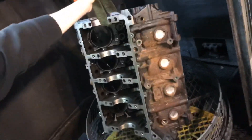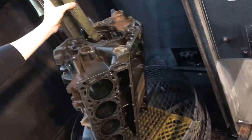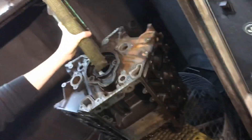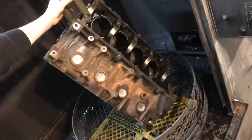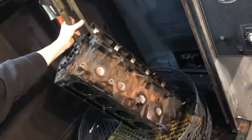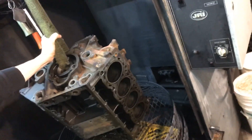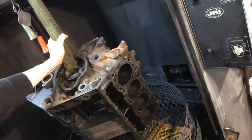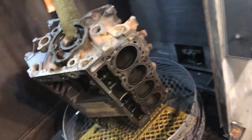Chris's block — there are quite a few spots. He opted to go ahead and do it because we're going to put a cam in it. We're going to ceramic coat these pistons — 20-over ceramic. The mains looked okay, but something was weird with the rods. When we were barring the engine over before we took the bed plate off it was not happy at all. As we took the rods off it got easier and easier to spin. We've got to run the rods through the gauntlet — check them for bend, twist, stretch, everything.